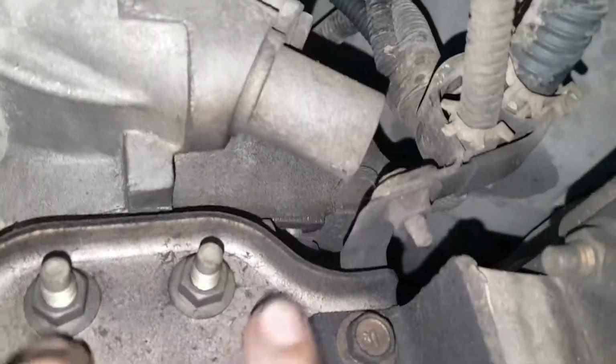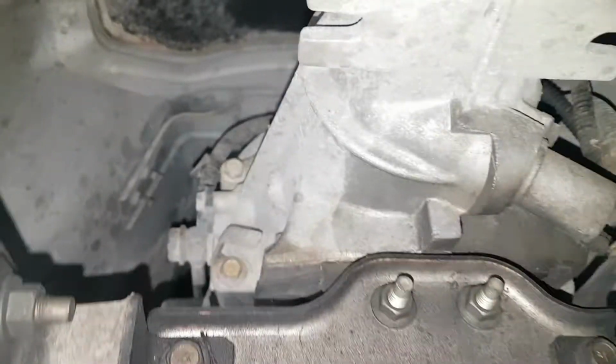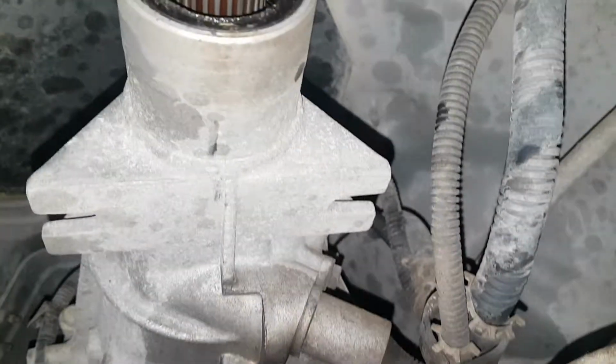I'm gonna open up this harness so I can disconnect that. No, I'm not. That harness isn't connected to the transmission. When I undo this, it'll stay on there. Then I need to undo the support beam that holds the transmission up. So let me go ahead and do that, and that will be in the next video.